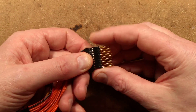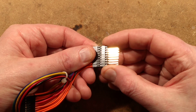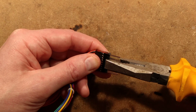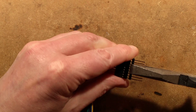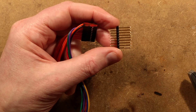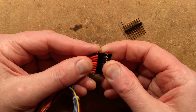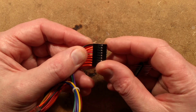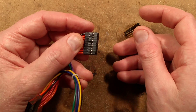It's using DuPont style connectors, and interestingly, instead of using an actual plug they've used a DuPont twin row socket. If I grab hold of this connector here, it is literally just a pin header that they've put into a socket, converting that socket into a plug. That's reasonable enough — it's probably easier to do it that way. They could have also used the standard DuPont style pin system, but this is really solid, so I can guess that's why they did that.